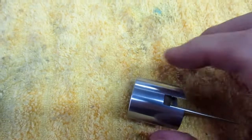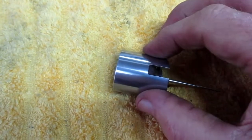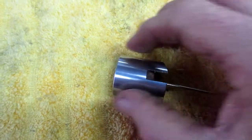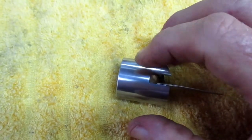And this is something you have to consider if you're going to do a swap of carbs from two Sudco identical carbs that are replacing two on the RD, that each one is a mirror image. You've got to take this into account. And this is the slide you have to use.